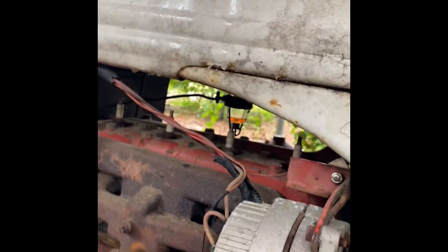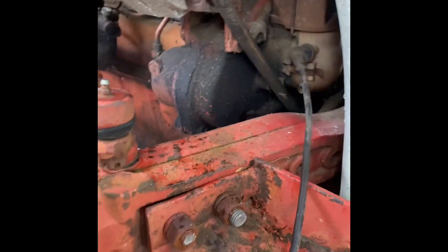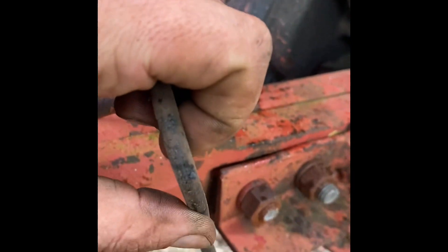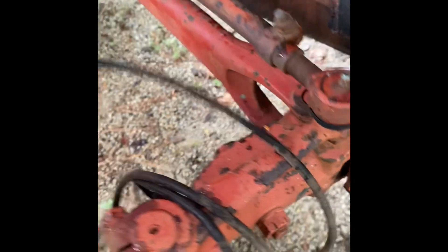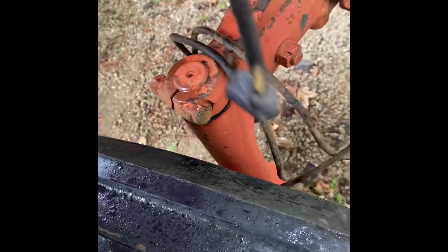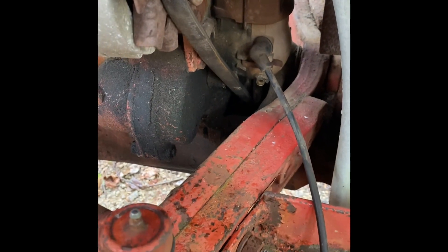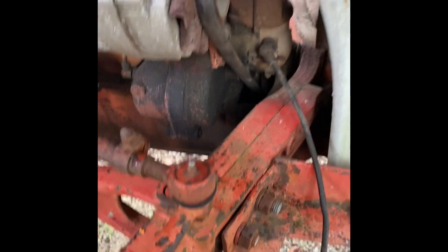Finally got time to check her out — she doesn't have any spark. The plug wires are pretty bad anyway; they needed new ones. They were all gouged up, and one of them has a spot where the whole belt was rolled through it. Went ahead and got a rebuild kit — the distributor cap was cracked on the bottom. The kit comes with a new distributor cap, everything to redo the points, new plug wires, and plugs.